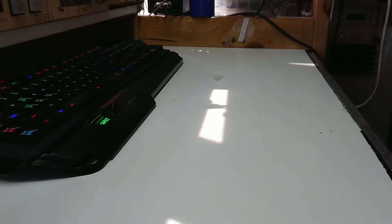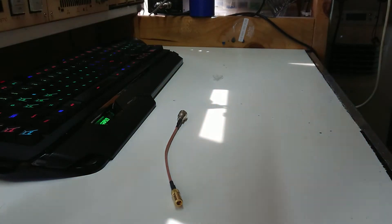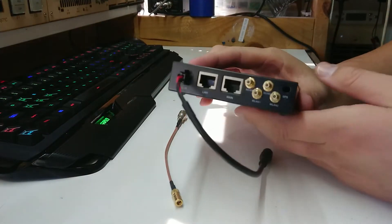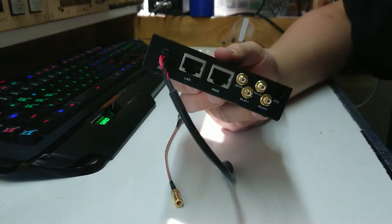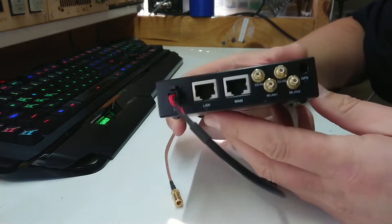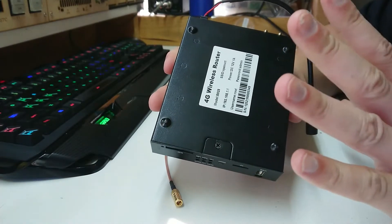So what are we doing today? A little FME to SMB connector adapter has shown up. Recently I ripped the modem out of my Land Rover. This is a 4G LTE router, but what I wasn't aware of is that when I ordered the correct one, they sent me one set up for South Africa, which will only handle UMTS frequencies in Australia — it won't do 4G LTE on the 700 megahertz band.